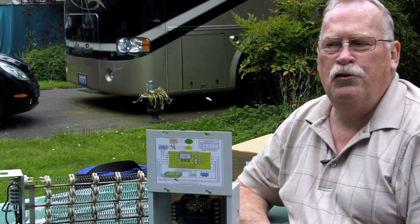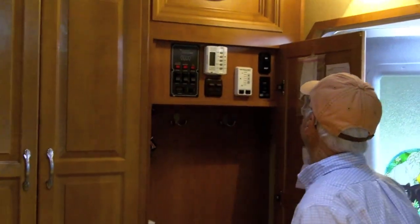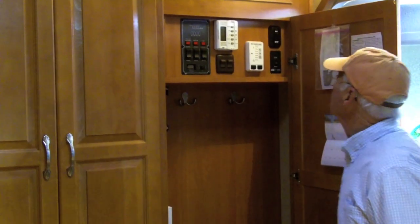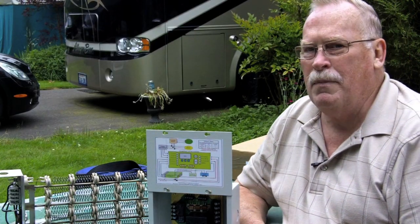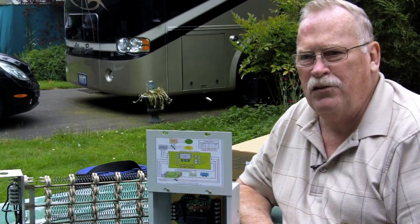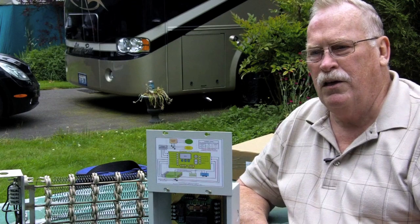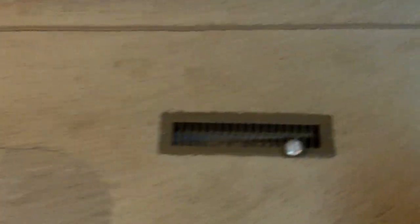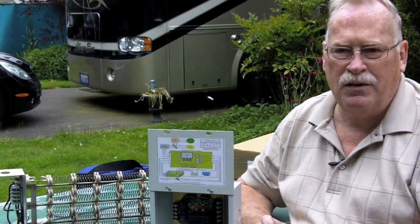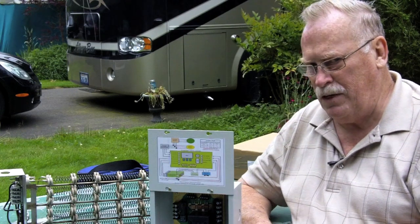What are the advantages to the end user of installing our Cheap Heat system? The main advantage is the ability to use electric over propane. Whenever they're plugged into an RV park, they don't have to worry about running out of propane at three o'clock in the morning and not having any heat. They don't have to worry about paying the additional cost of propane, because with the Cheap Heat system they can provide 100% of their heating needs with the electric forced air system. Not only does it heat the upper part of the coach, by tying into the central heating system it allows them to heat the basement as well, and it prevents freezing of pipes. You can also look at the cost associated with electric versus gas — in the majority of cases, even if you were paying for the electricity, it would be cheaper.